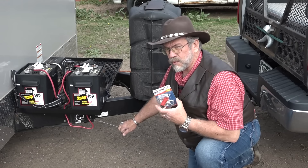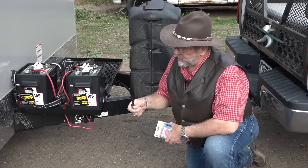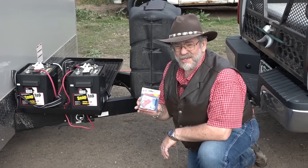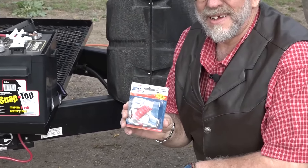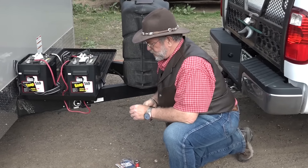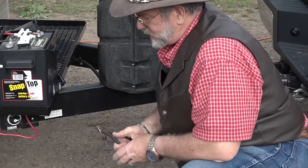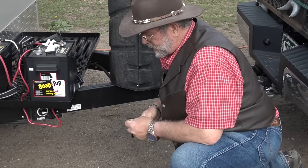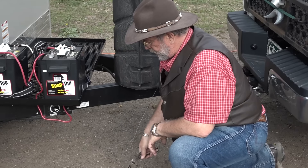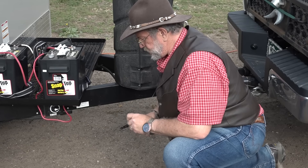Another thing I always put on all my trailers is these Fastway Zip breakaway trailer cables. A normal cable always gets hooked on things, and I hate those. So I'm actually going to change it out — that, of course, locks my brakes up. I'm going to change this cable out and put this zip tie on there from Fastway. I'm cutting the old cable off. I need to reuse the tab that goes into your breakaway tab for your brakes. You can buy them either way from Fastway — either with a new plastic tab or with just a keyring style so that you can hook it back in there again.